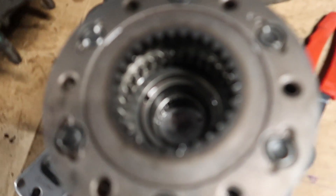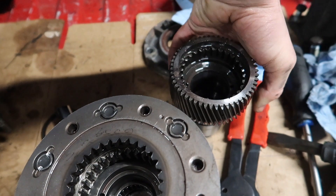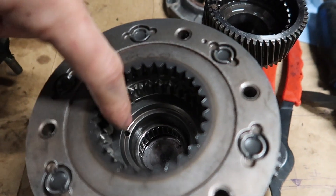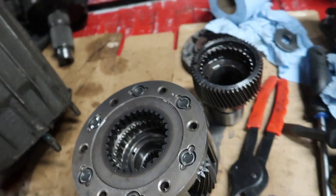Take a look in here — that's my new input shaft, and there's the old one. You can see there's the cap right there, and this bearing. You have to drive those into the input gear. It's not hard to do at all. I just took a 19mm long socket and tapped gently — it popped out. Spun it around, drove that cap in until it hit. Then take your bearing and, ideally, if you have a bearing driver that's what you'd use, but just tap it in until it bottoms out.